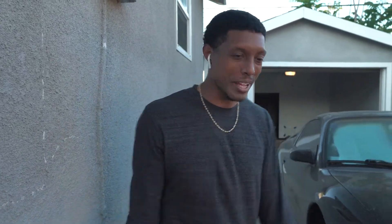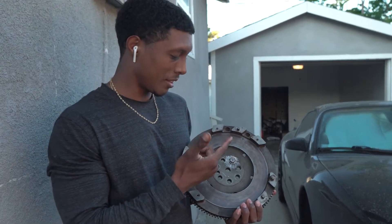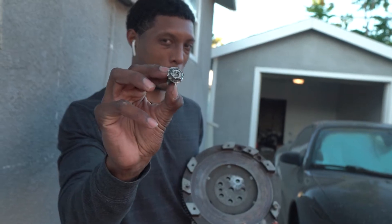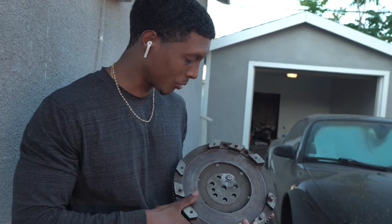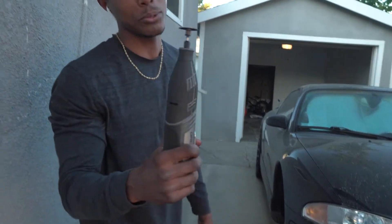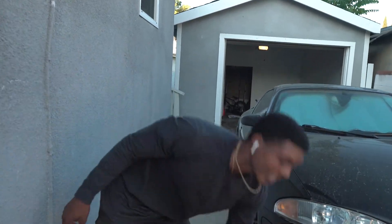The car's been down for about two months or so. It's been a long time and it just hasn't gone my way. As you can see right here, I've been having a terrible time with the flywheel bolts. They were super tight and some of them were already rounded, which created a super big problem for me. I had to go through several tools to try and get some of these bolts out, and this one right here wouldn't come out with any of them — it just got worse and worse. So I had to go in there with a trusty old Dremel tool and cut away at the lip to separate it from the flywheel so it could finally come loose and I could get it out with some vice grips.